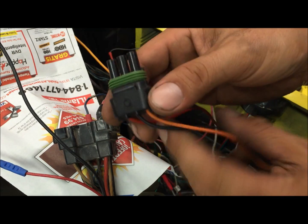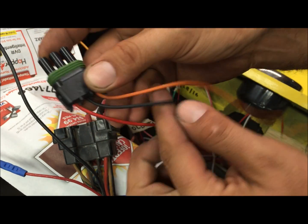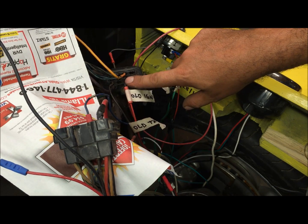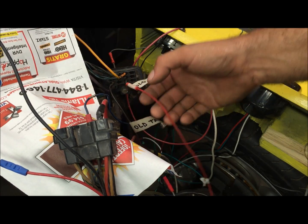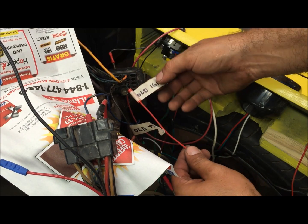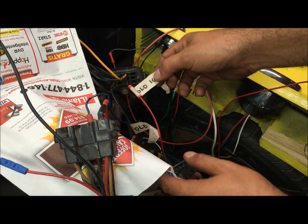Each one of these boxes is going to be a little bit different, but on this box it has a plug connector. The orange and black are going to go to your coil — negative and positive on your coil. Then this wire goes back to ignition-on with the key. I just cut mine out of the harness; this used to go to the positive side of the coil. I just cut that wire and spliced this straight into that in the harness. Tie the red wire to the old ignition wire — this is usually orange, red, or yellow.